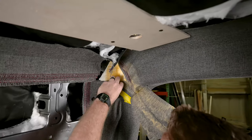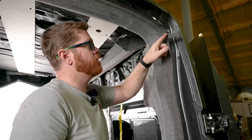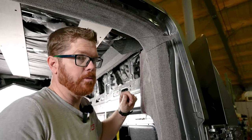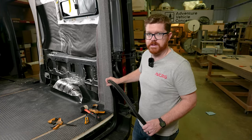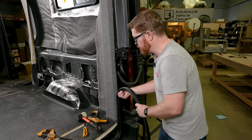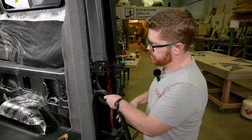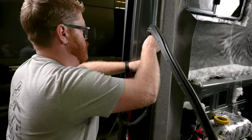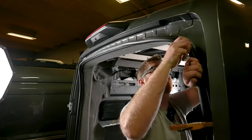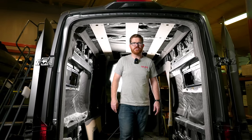Now that our glue is kicked, I'm going to peel off my top piece of tape but leave the lower piece in place for alignment. With our seam cover in place, we're ready to trim off our little tag end and reinstall our bulb seal. With our wrap complete and our edges trimmed, we're ready to reinstall our bulb seal. Just remember to roll your bulb seal onto that fabric so we don't peel anything back, and having a clamp handy is going to help as we get to the top. With our bulb seal installed, it's another job complete. If you found this video helpful, hit that like button and subscribe to our channel.